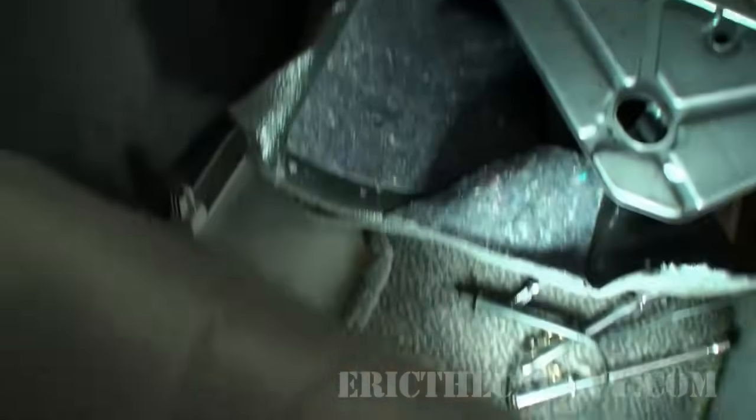I have next to me a 1999 Acura RL, which is clearly in the OBD2 range, yet I can still pull codes the old way — you've been able to do this pretty much since the early 90s, like 1992 or 1993. Before this option, there's normally a flashing red LED on the computer itself that you would use to get codes, so you wouldn't have to short anything out. On OBD0 Hondas you follow this same procedure except you've got to find the computer — a lot of times it's located under the passenger footwell. You peel the carpet back and you might see a little inspection window with a red flashing LED, or on really old ones like the original LXIs, they were located under the passenger seat with a plastic inspection window you'd pop open.